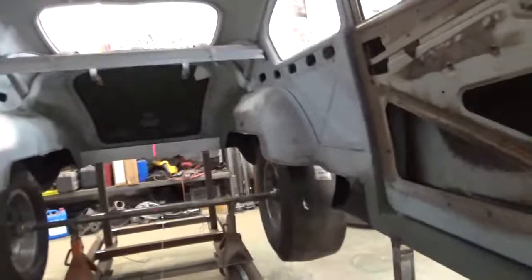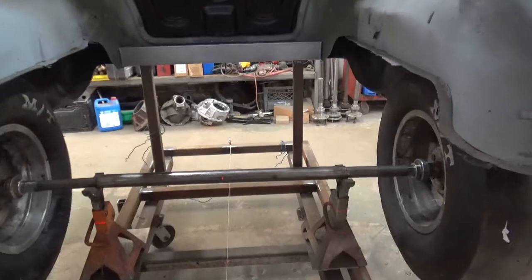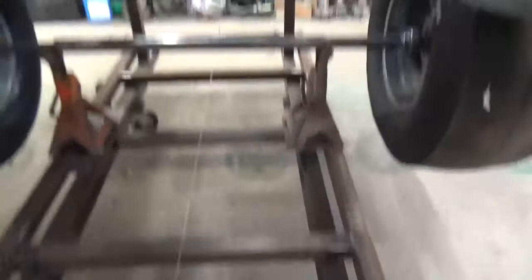Once you get all that ready, we know we've got the wheels in the wheel opening where we want them with this tube. We measured from our fixture line to the centerline of that tube, and that gave us an axle centerline dimension, which in turn tells us where the housing has to go in the fixture. We'll get that done and I'll show you a picture of that.